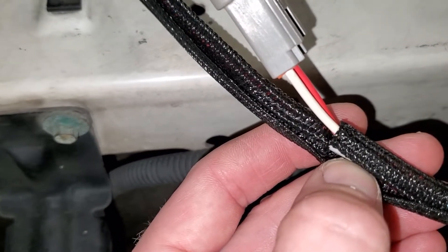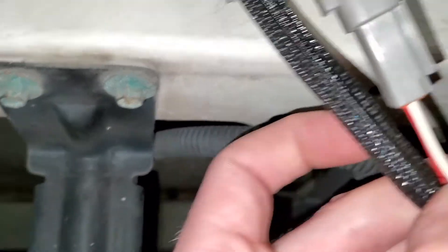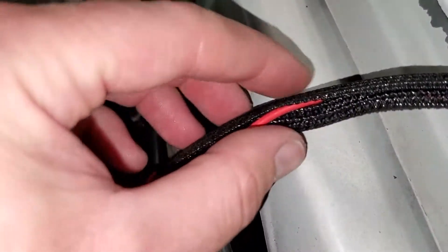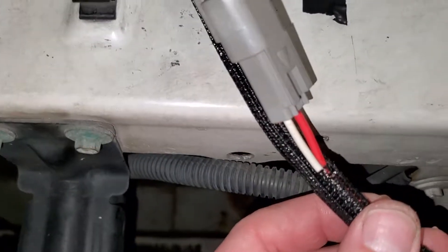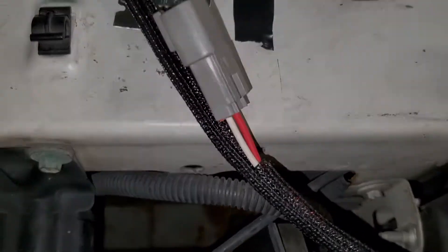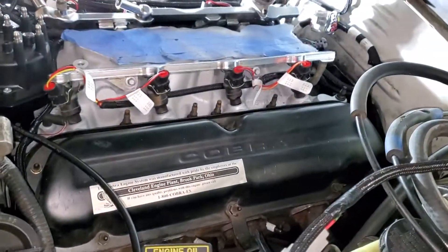For the tech flex, if you have something that branches off, I've had good luck just using a pair of Dykes to cut a little notch. It'll wrap around and lay down and then you can tuck it away and put some electrical tape on it. If you don't do that it'll kind of bulge out, and you can tape it that way but it just ends up looking garbage. A razor blade doesn't cut this stuff very well, so I recommend a pair of Dykes — cuts very nice. Here it is all tech flexed up with the connectors. I'm gonna route it and see how it looks.